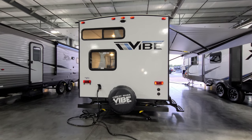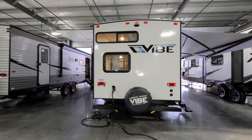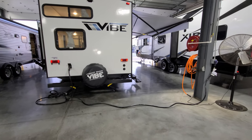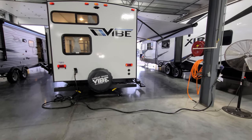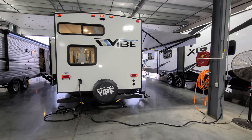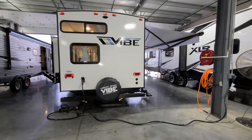In the lower right-hand side there's your cable or satellite inlet into the RV, so if you're at a campground with cable or satellite — or even in your backyard — you can hook right up to the house. The power cord is on the left side and is detachable. This unit was ordered with two ACs so it came with a heavier-duty 50-amp electric service with a cord about 25 to 30 feet long. If you go with the standard one AC and 30-amp service you'll still get a detachable power cord, just not as heavy duty.